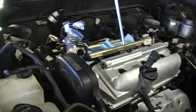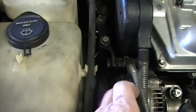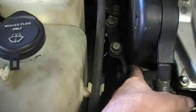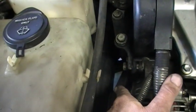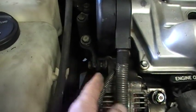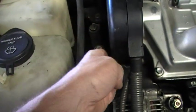One other quick thing on the front here: this particular wire goes down in between the front top motor mount and the timing cover case down where I'm sticking my finger. If you run it this way it's going to hit the belt, so you have to properly support the engine from the rear, then take the top bracket off — it's not very deep — and you can actually get it out. I'm getting ready to put it back in now.